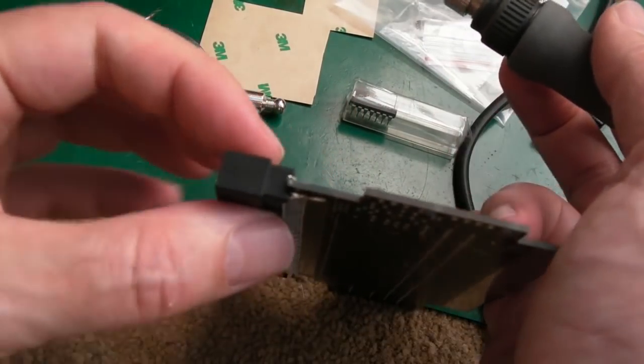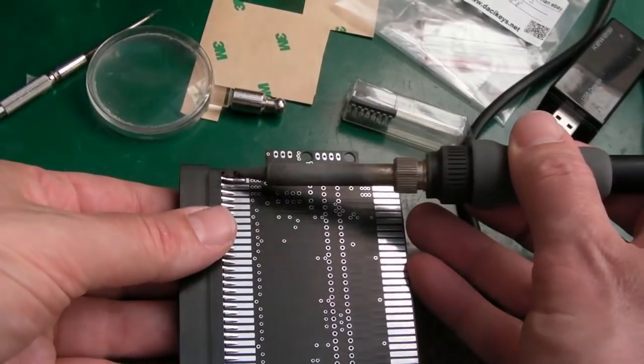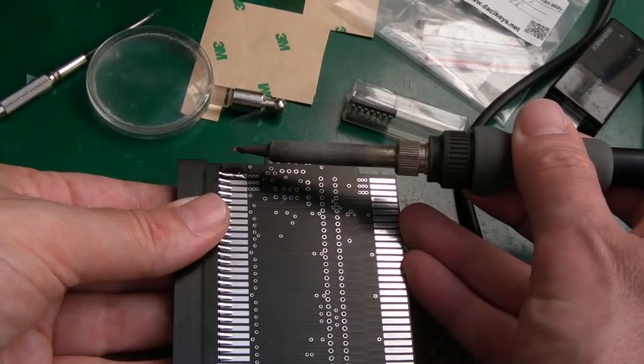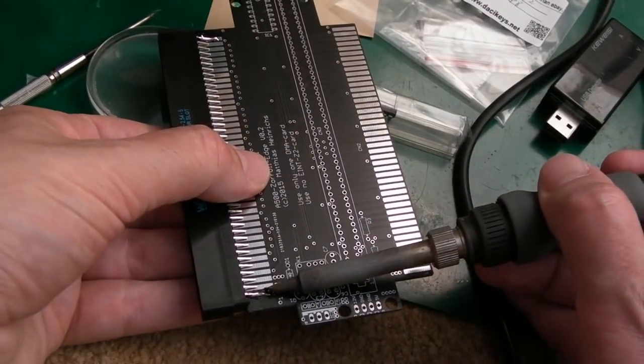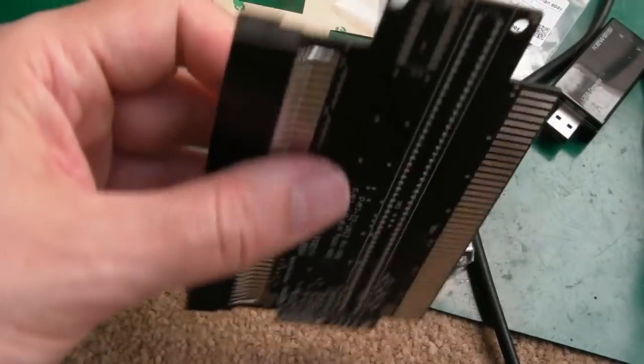Yeah, it still needs a little bit more, because can you see it's kind of pointing down this way just ever so slightly. It's so subtle, and if you've soldered too many connections, adjusting it would be very, very difficult. Yeah, that's straight. So I'll just reflow that side now to release the tension. You can hear it click there when I did that. There we go, dead straight.